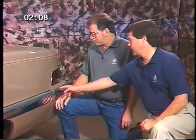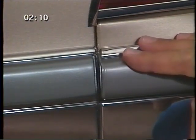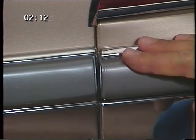We have seen mismatches at the rear fascia, and that's because the rear fascia is installed after the molding. If you ever get a complaint about molding fit, you might have to simply adjust the rear fascia. What's an acceptable fit here, Al? What's normal? The rear fascia molding and rear side molding should be within 2 millimeters of one another.